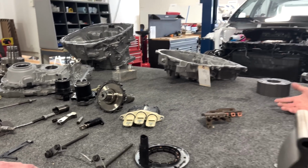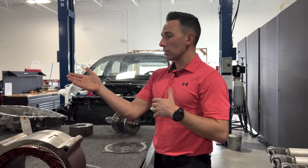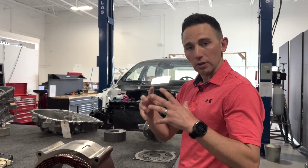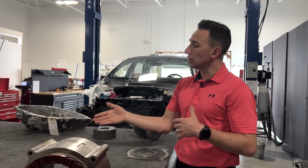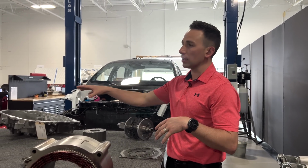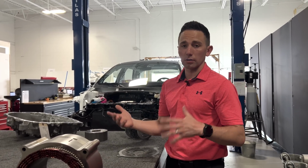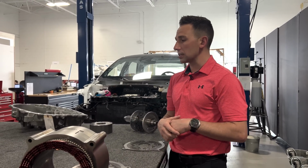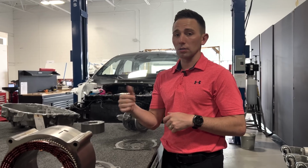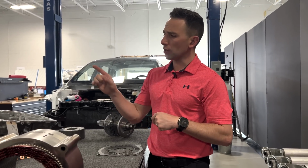Nowadays, with electronic parking brake, it's actually actuating the brake caliper of the vehicle. Those are what's being used to omit these, right? So you get just the EPB, the motor on caliper unit, and you can omit the park pawl. But, and this is speculative at this point, with a vehicle that's the form factor of the Hummer, 9,000 pounds plus curb weight, significantly higher GVWR, the gross vehicle weight rating, what it can hold in its entirety, it may be that they have a front park pawl, or that they have a park pawl period because of the additional vehicle mass, but it's unique that they put it on the front axle.